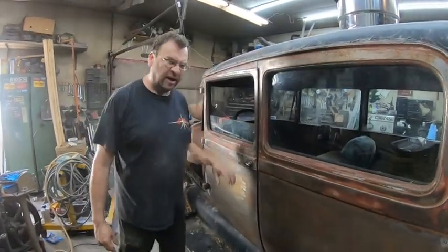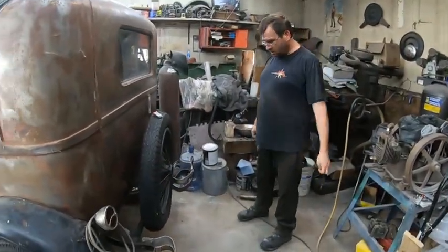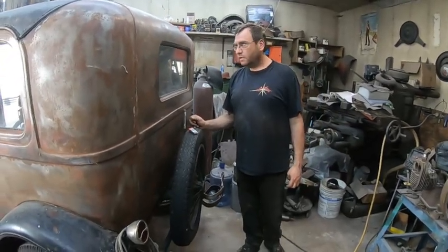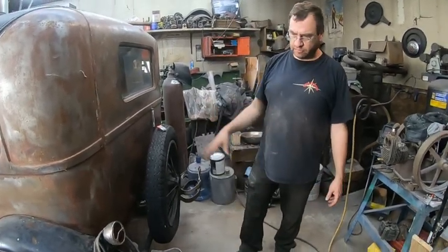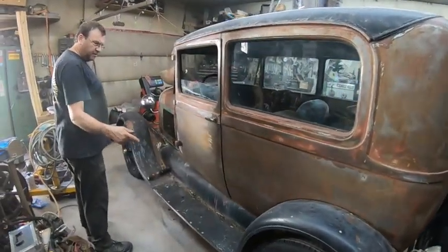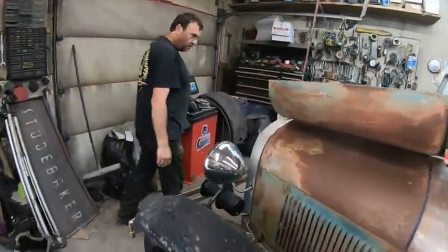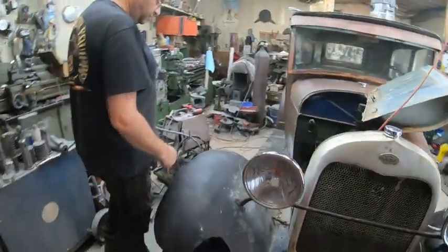The plan is, this is Ryan's. The plan is, as of today, Ryan wants to put a flathead V8 in it and an S10 5-speed into it, so it has an overdrive. So that's gonna require a little bit of engineering, motor mounts, tranny mounts, keeping the rear diff, I believe. Yes. So modify or getting the adapter from a torque tube. And a little bit more work on me and Derek's part, but it shouldn't be that difficult.